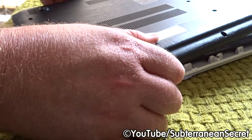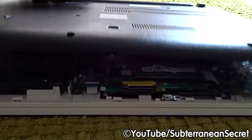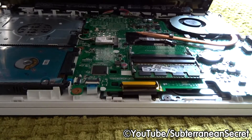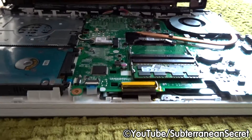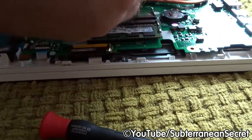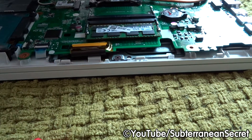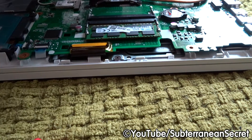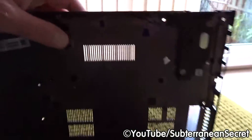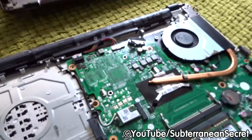Do it gradually all the way around at a slight angle. Before you pull the complete panel off, be careful — there may be cables. In my case there's a little cable which goes to a sensor connected to the motherboard. I've already disconnected it, but just take note of where it came from. Make sure it's unplugged and note where it connects.